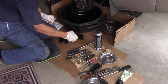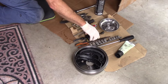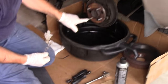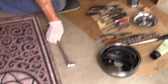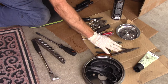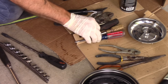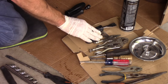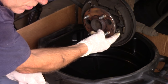Obviously we are going to replace the brake shoes and the drum. You are going to need a longer ratchet with those bolts to take the drum off. Once you have the drum off, we are going to need a couple pairs of pliers — a long needle nose pliers, possibly a regular pair of pliers — a couple of different screwdrivers, some locking vice grips, a scraper, another scraper, and a couple of tools like this to get these springs off of the car.